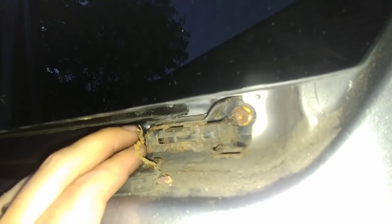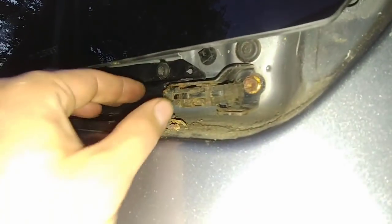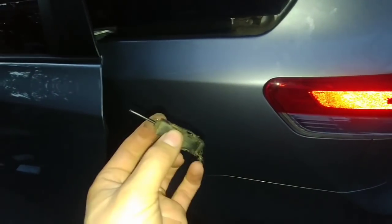This is the bracket you're trying to get to — you can see it's where the cable comes in. I cut the cable earlier, which is why it's not extended. This is the track the cable runs along the side, which is what the door pulls against as it opens. You remove this nut with an impact driver and hex wrench. If you can just get your fingers in and pinch this little plastic piece, the whole assembly will slide right out.